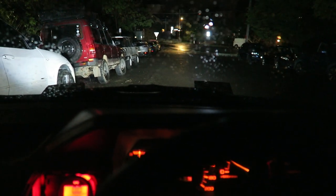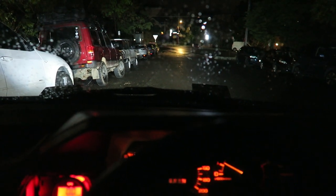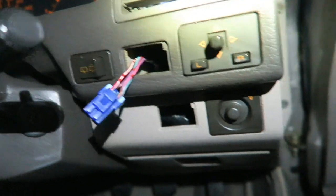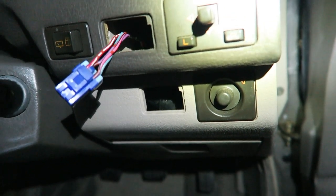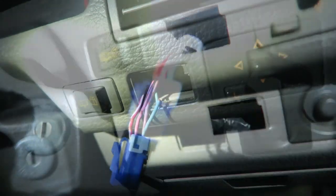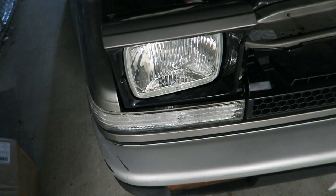You can do this to any car, not just this one with flip-up lights, but this is probably the hardest one to find because of the flip-up lights being so uncommon. While I was playing around with the headlights I thought, why not do the sleepy eye conversion? For S13s you're supposed to cut the brown wire, and for S12s you're also supposed to cut the brown wire. As you can see there was no brown wire, so I saw someone mention to cut the green/teal wire, which I did — and that led me to: when I press the button it pops up, but when I press the button to pop down, nothing happened. So now I've got headlights that stick up and I'm going to have to rewire that.